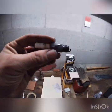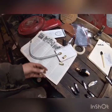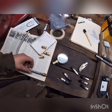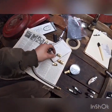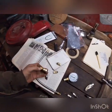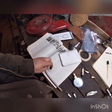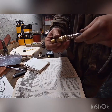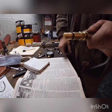Cylinder number two — see anything wrong with that? So we've got all these fancy little adapters here, the hose, and the gauge. What I need to do is take one of my spark plugs — I'll take my nicest, fanciest one right there — and this looks like it's about the right size. Threads fit together pretty well. I hope that's the right size because that's the only one relatively close to what I need. Smash the o-ring down just enough to seal it. Doesn't have a way to put a wrench on, so I'm just gonna turn it the best I can with my hand. That looks good.